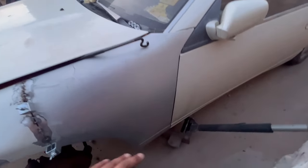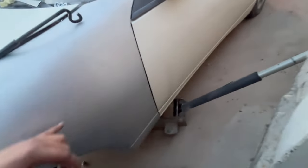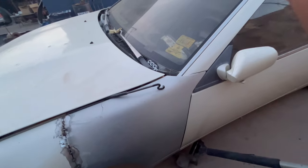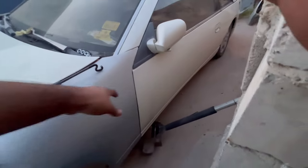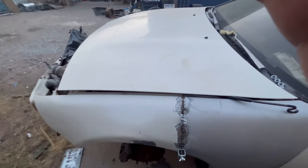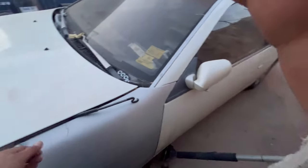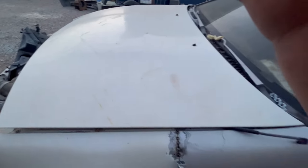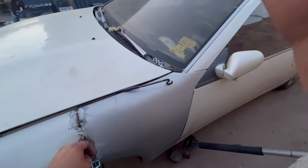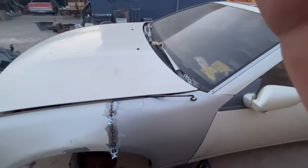So what I'm gonna do now is with the original fender — I'm gonna cut the vent, make my shape, fold the metal, and make patch panels to fill in the gap. Then I'll put that chicken wire on the inside — it's not really called chicken wire, but that's what I like to call it. Right now I'm welding this fender together. I got my gaps pretty straight, and I removed one side so it would not mess with my alignment.